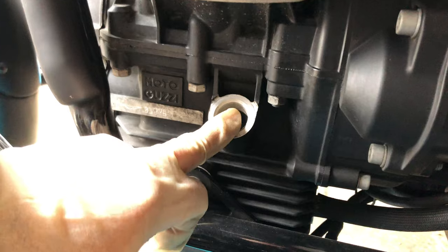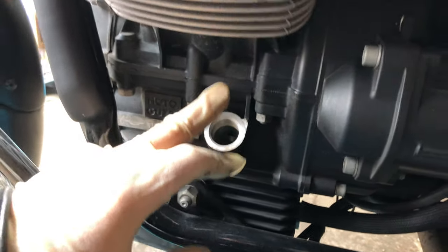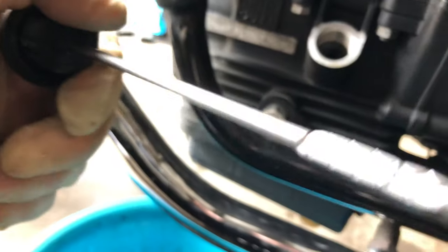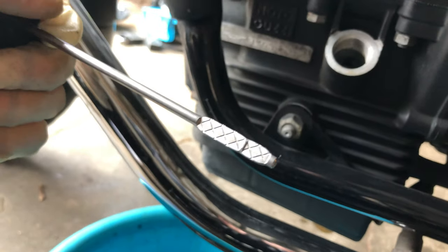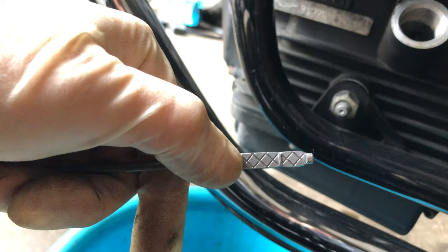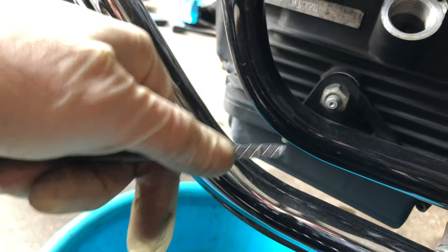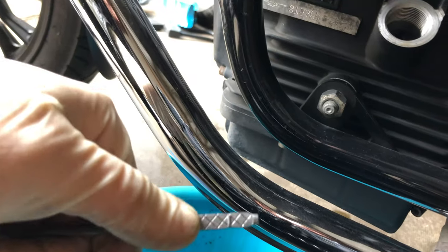So really all that remains is to put the oil back in. The important thing at this point is to remember — on the dipstick — you absolutely do not overfill this engine. What will tend to happen is excess oil gets pushed out into the air box, and then you ruin your air filter.